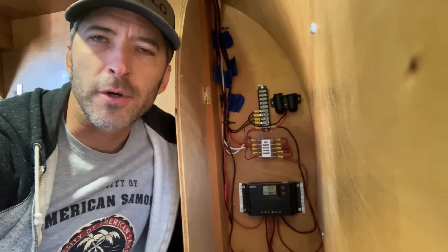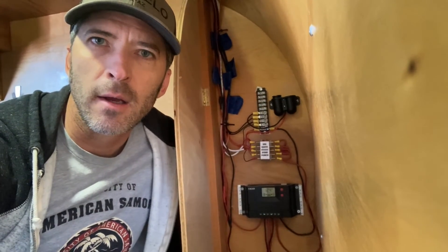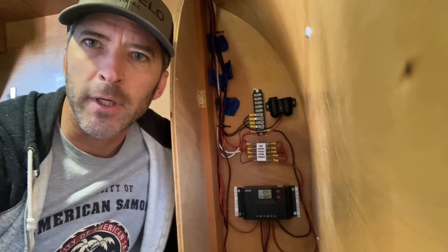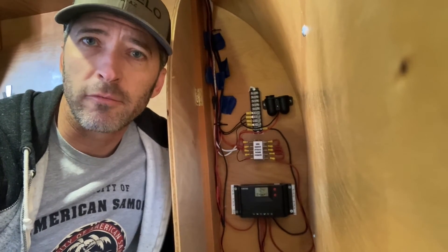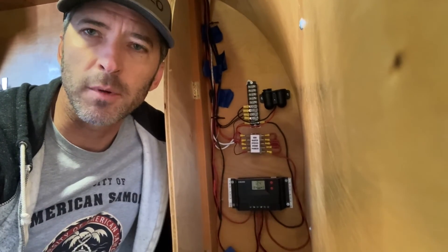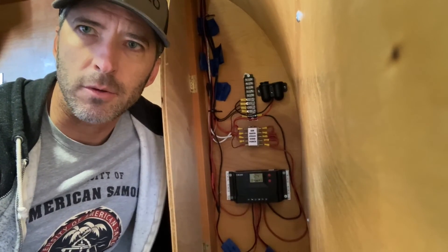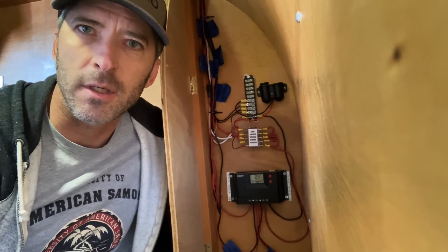This system is completely independent from the plug-in to your vehicle bumper that runs your brake lights and turn signals. It's completely self-contained and I chose to build it without an external power plug or shore power — I just wanted a completely independent, simple system. If you store the trailer inside and run the battery down below the level needed to power the charge controller, all it takes is a simple jump start from your vehicle to re-energize the controller and get back to charging in the sunshine.